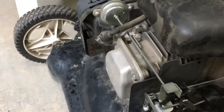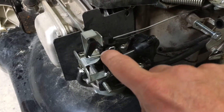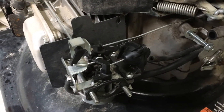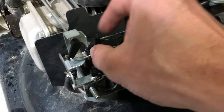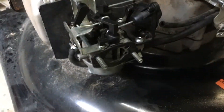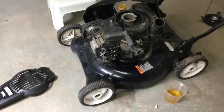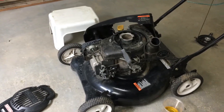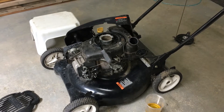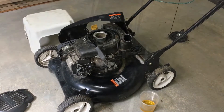If this were going to be mine to keep, I'd just figure out some kind of manual choke — hardwire a little wire onto it and be able to open and close it that way. Once they're warmed up they're good to go. But this thing has a high chance of failure — starts closed and may never open on you, and if it doesn't open it may never run. Anyway, we'll put her back together, get some clean fuel in it, and give it a whirl — see if she starts. The question is whether that choke will open up and allow it to breathe and cut grass.